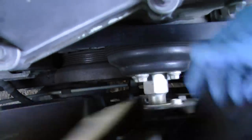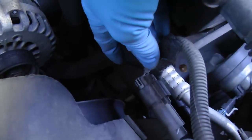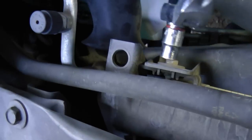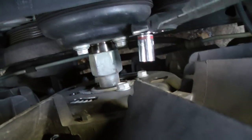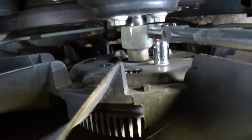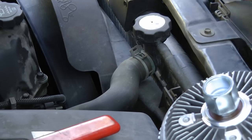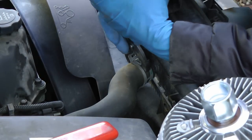As you can see now, you can just spin it off. With it loose, first you take off the electrical connection that powers the fan clutch. Then you remove the bolts that hold the plastic fan cowling in place. Also remove the bolts on the back of the fan, because on this design there's no working room, so you have to take the fan off before you get the fan clutch off. And you also have to remove this radiator hose, because it's in the way of getting the cowling out of the way.